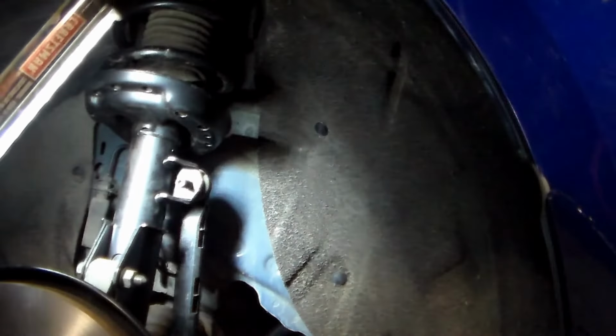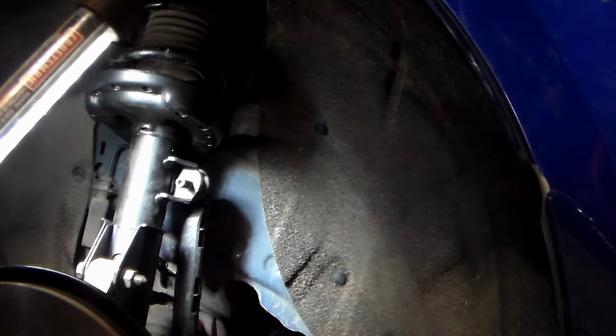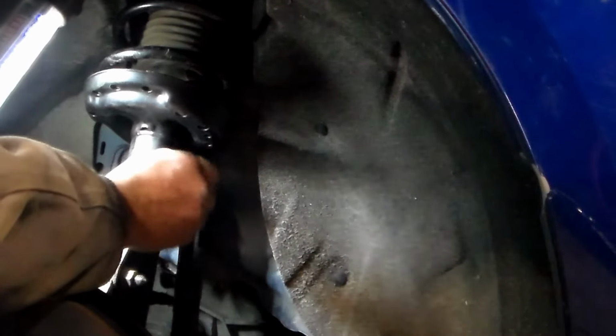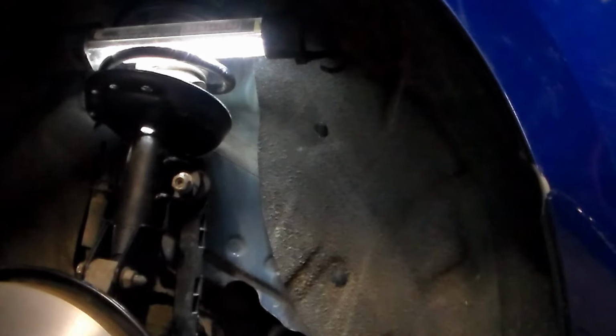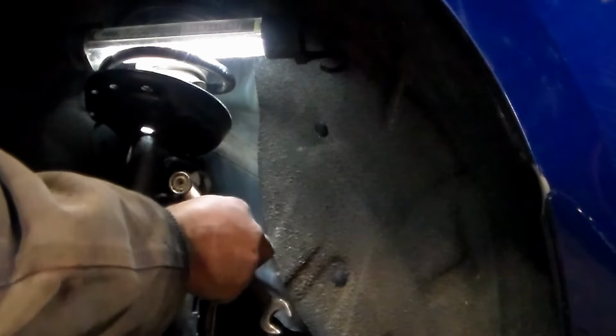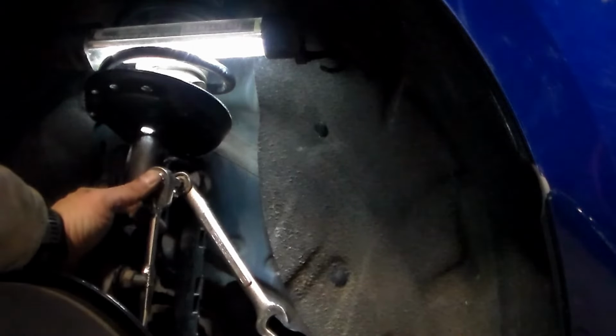Next thing we have to do is put this arm back on. So go ahead and bring this arm over. And we're going to... Oh, that actually fit through there pretty good. That popped right in. Sometimes you may have to lift the jack up or down on the control arm here to get that to line up. But just line it up so that it feeds right through like it did there. And we'll go ahead and put this on as far as we can by hand. It's going to go about that far, and then we can go ahead and tighten that down. Now remember, we have the Torx on the inside to hold, and also then the wrench on the nut. And hopefully I'm not blocking the camera view, but you can see what we got going on here.